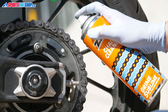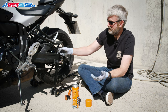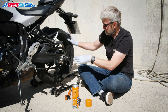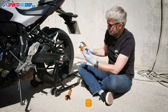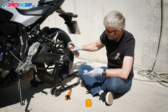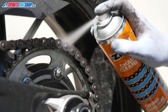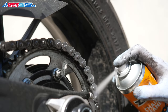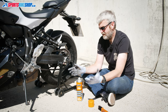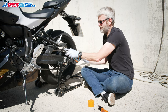Once I've done a section, I spin the wheel around until the part I've cleaned is underneath, then spray the next section. I know I've covered the whole circuit of the chain because I can see the brush marks from where the scrubbing has been. When you reach the bit you think you've already cleaned, that's the rewarding part — spray it off and the chain links come up nice and shiny, getting rid of all the residue and gunk. Once I've been around the complete circle I give the wheel a good spin and spray on another coat.